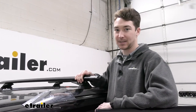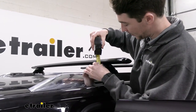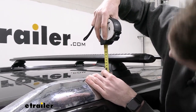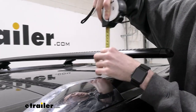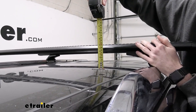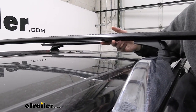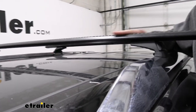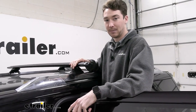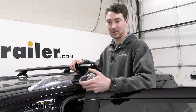One thing to note about a roof rack system is that it's going to add a little bit of height to an already pretty tall vehicle. In the case of these crossbars, it's about 2¾ inches from the rail to the top of the system. From the bottom where you're making contact with the roof to the bottom of the crossbars is 3¾ inches — that's how much room you'll have for clamp-style accessories. Factor in the height of your accessories for things like garage storage or clearance issues.